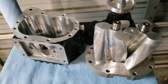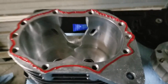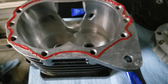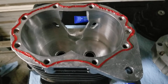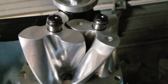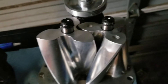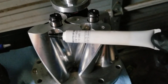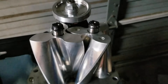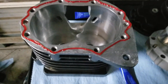I'll show you guys exactly how to set it in. You see how it's just a thin line going all the way around the outside area of the flange — I'm going to smooth that in ever so slightly with my finger and then set the rotor housing assembly in. I put a little bit of grease on the end of the supercharger lobes — this is a very special grease, don't put regular grease in there, it will destroy it. It's a special tube of grease I had to order, for a little extra protection.